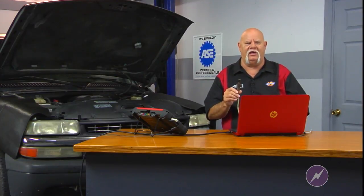So there is a possibility that you're going to replace the oxygen sensor only and fix the vehicle. However, that is not the norm. If you remove the oxygen sensor from an exhaust manifold or an exhaust pipe and it's rich fouled, you may be replacing the effect and not the cause.